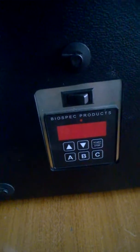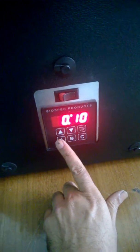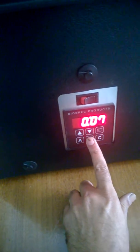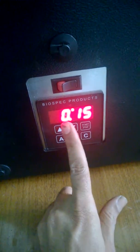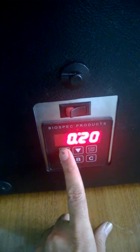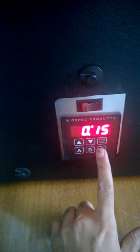Now coming to the front — this is a digital display and you can see it is off at this moment. To put the display on, press this switch. You will see that there are three keys: A, B, and C, where you can store three timings. Suppose A is 7 seconds and on B you want to store 15 seconds — increase it to 15 and hold B until there is a beep sound. Now it is stored at 15. If you want to save C at 20 seconds, move it to 20 and hold C until the beep. So A is at 7 seconds, B is at 15, and C is at 20.